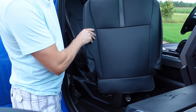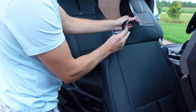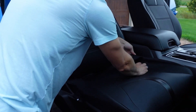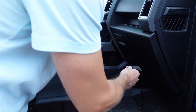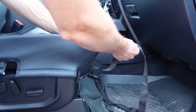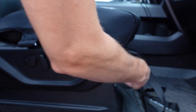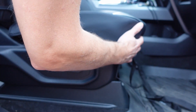Now for the seat base, you're going to have three straps. Start by sliding the three clips back underneath the seat base, locate the hole for your seat belt and slide that through, then feed these three straps underneath your seat to the back and attach them to the clips. When feeding these straps underneath, make sure they don't interfere with any of the wiring. It's recommended to wear gloves because there are some sharp objects located underneath — you don't want to cut your hands up.